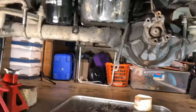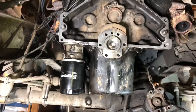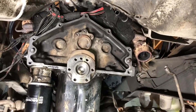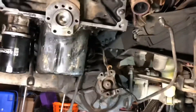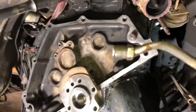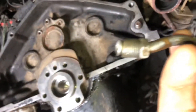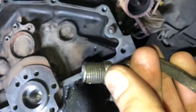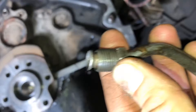We are back. I just got done cleaning everything up - basically scraped the oil pan, scraped the oil filter adapter, scraped the back of the engine, cleaned up the inside, cleaned up the starter surface, and flushed the cooler lines. This one still needs to be bent. The fitting can't really slide back at all, and when it does it's slightly at an angle - that could be a potential leak.